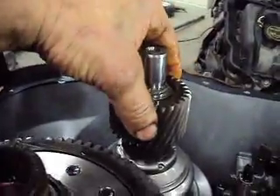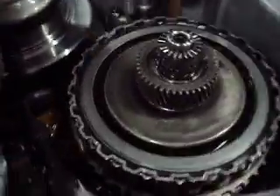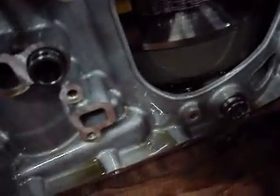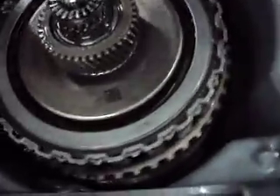There's a feed tube here that goes up and feeds this bearing — that would be this shaft right here, the secondary shaft or countershaft. As you can see, there's a chain in there and that's what drives it, along with two sheaves that move in and out to adjust your gear ratio. And there is a clutch here — this is your reverse clutch. Theoretically the car should go just as fast in reverse as in forward, although I'm sure the computer will correct for that.